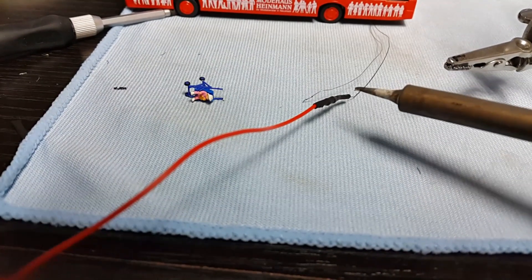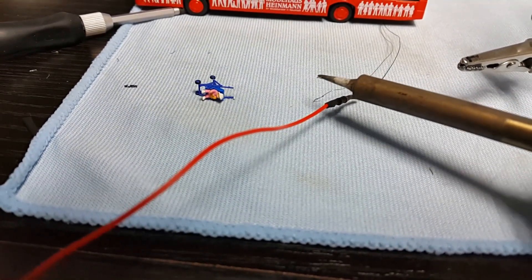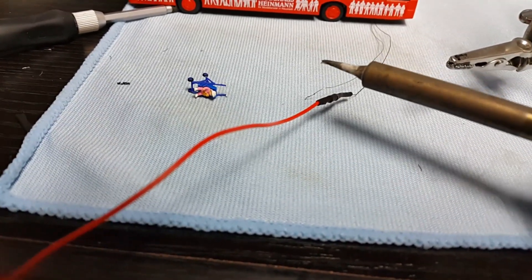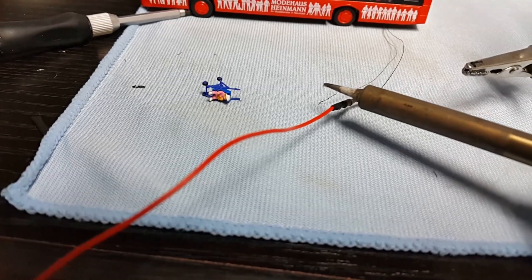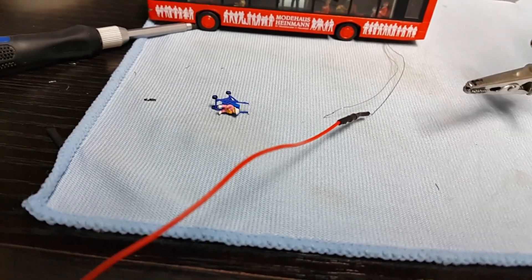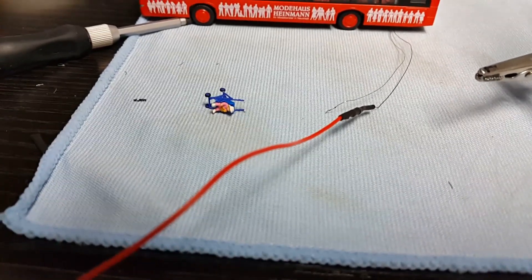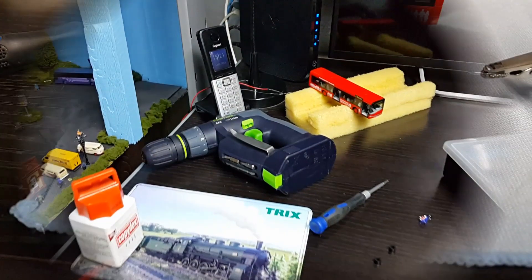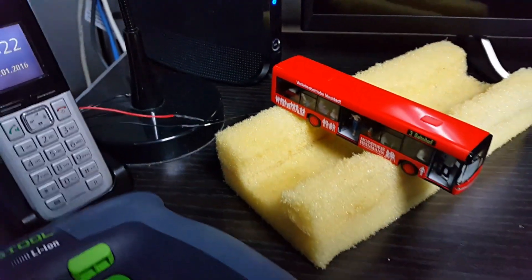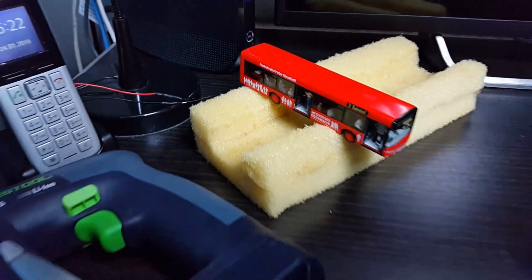To shrink the heat shrink, I just place the tip - where the tip joins the chassis - and go along like that, as close as possible. It shrinks up the shrink tube. No need to use a heat gun. So the bus is ready to go back, it's all wired up. I need to get a couple more lights in there in the future, but I'm just putting one in for now just to light it up.